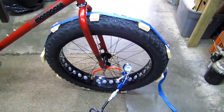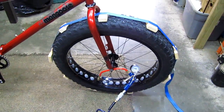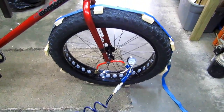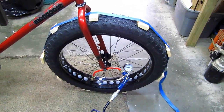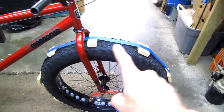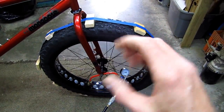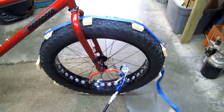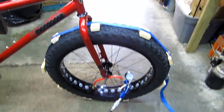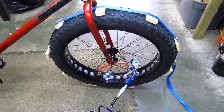I'm back — what an adventure this was! I put the tire back on the rim after doing all the taping and putting in the Stans valve. A trick I saw on YouTube was to put a 26-inch inner tube around the tire to compress it and force the beads outward. Well, that didn't work on this tire — this is a big monster wire bead tire. It might work on more supple tires, but I could not get that thing to compress and stick.